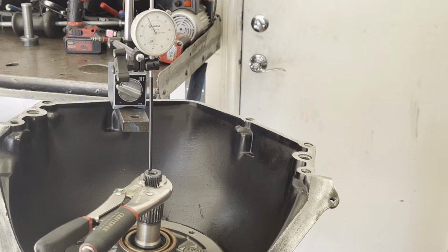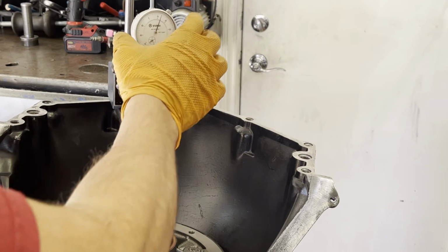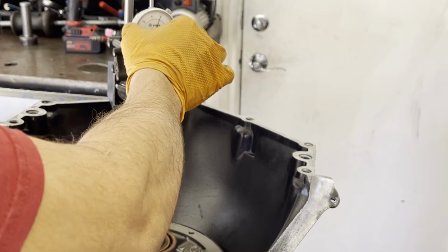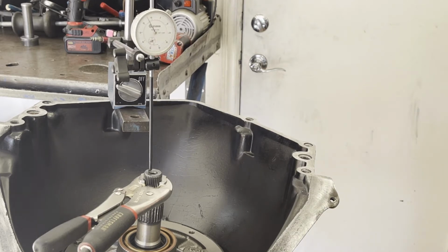The first thing you want to do is grab your long screwdriver again and more or less repeat the rear gear end play procedure. So take your screwdriver and stick it underneath the ring gear and pry up until you cannot pry up any longer. And then note the reading. So this matches our end play of looks like 12 and a half thou. Now zero the indicator at that location, because you do not want your front end play figure to reflect both front and rear gear travel.